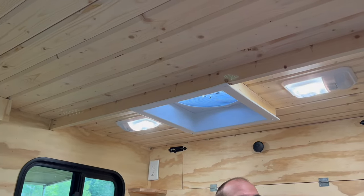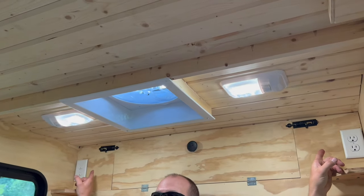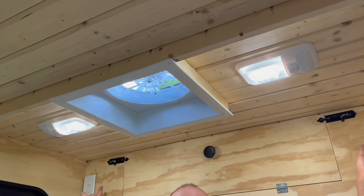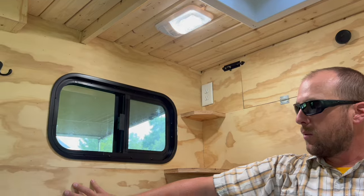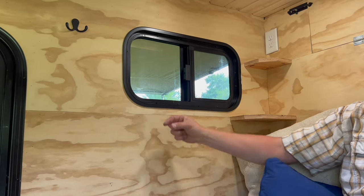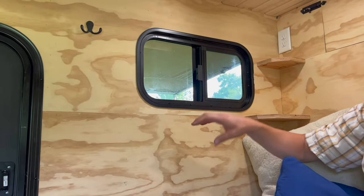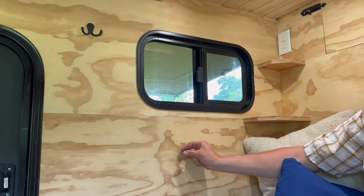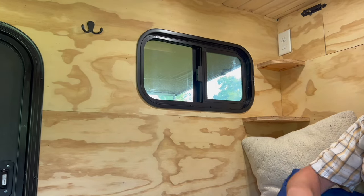I have lots of lights in here, and I put two more receptacles in the back corners. The interior is finished off with quarter-inch plywood — three-quarter inch on the outside, quarter-inch on the inside — with one-by pine in between and three-quarters of an inch of foam insulation all the way around the sleeping quarters.